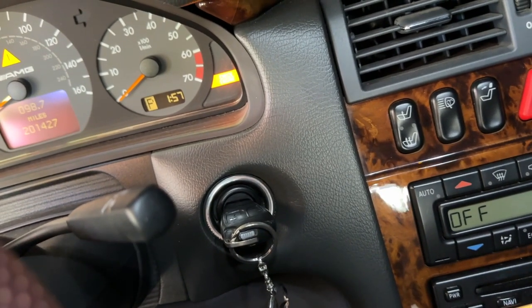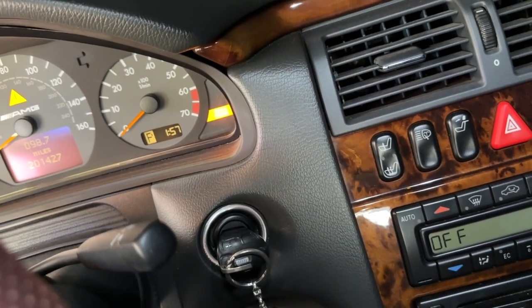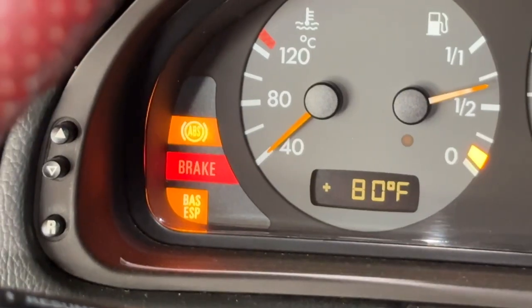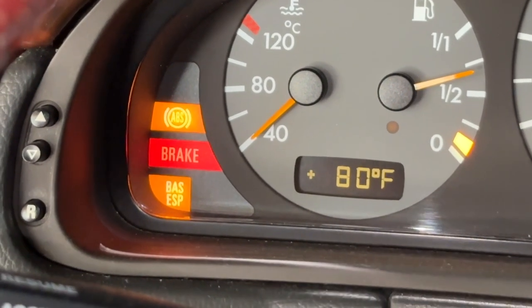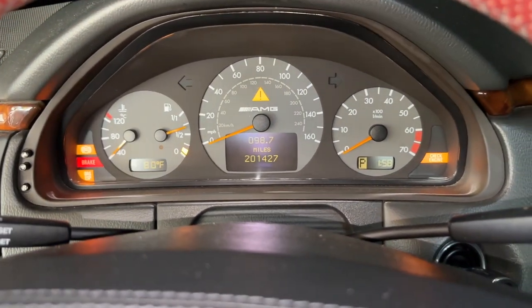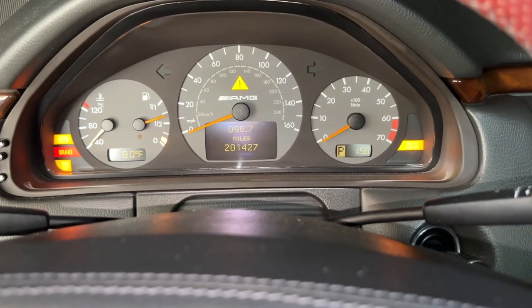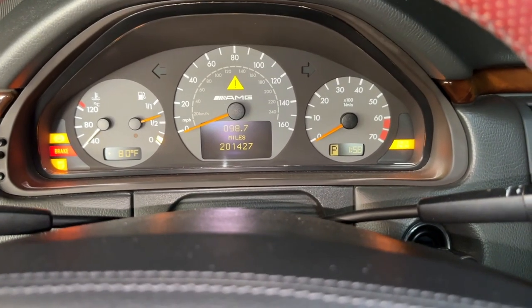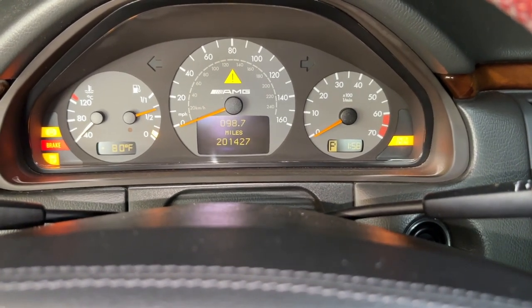In position two, if the brake light switch has failed, the lights will be on. We got no brake lights on in the back — which is good news. If the brake light switch was the reason for the ABS, BAS, and ESP failure, replacing it will also fix that. You have to turn the car on and drive it a bit to make sure — sometimes the car will have to cycle through and you'll need to drive a couple of miles to let the computer re-sync. If that doesn't fix it, then you've got another issue, but this usually will fix it.